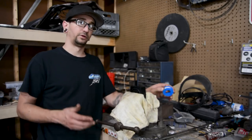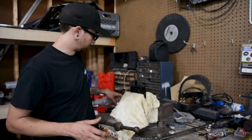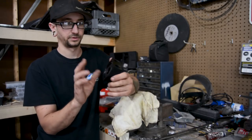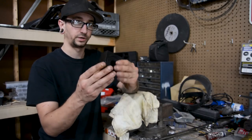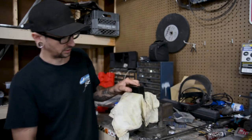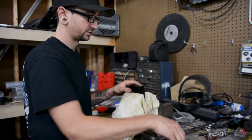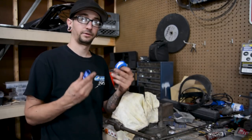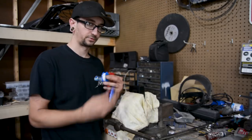The first thing we're going to do is get the oil filter block adapter installed on the vehicle. This is the oil filter block adapter — it basically sandwiches between the engine block and where the filter goes on. We're going to get that installed, but first we need to put our fittings in there. These are half inch MPT fittings and we're going to go ahead, throw some Teflon tape on them and thread them in there.